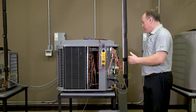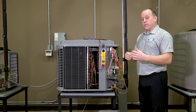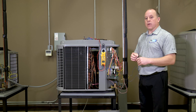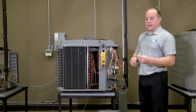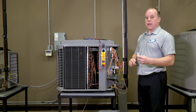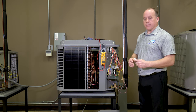If you did have them all in line with multiple pressure switches, you could check the voltage, but you'd have to check at the different points and see where you're failing — and it's not always easily accessible with the power on to get to those locations. So sometimes it's a lot easier to separate them with the power off and check the continuity of the switch to find out if it's good or bad.